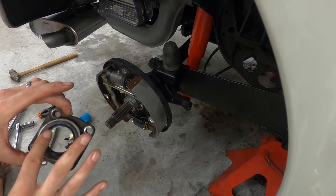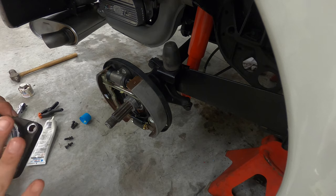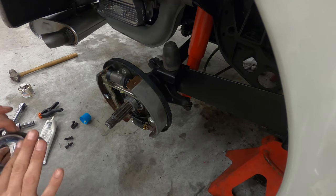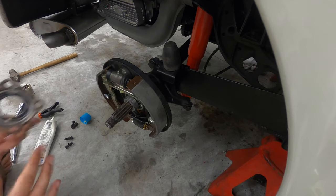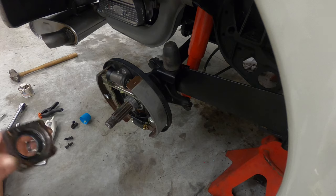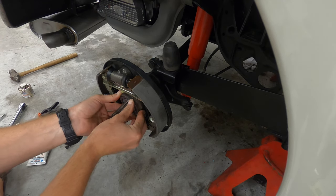On the gasket there's a little hole on the bottom for this model — it doesn't make a huge difference but I'd still put it at the bottom. On this model there's normally a hole on the bottom of the bearing cap for it, but this one doesn't have it. Put this piece on and make sure you're not pinching that big O-ring — you'll feel it, just do it by hand.